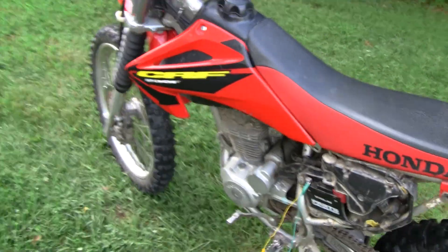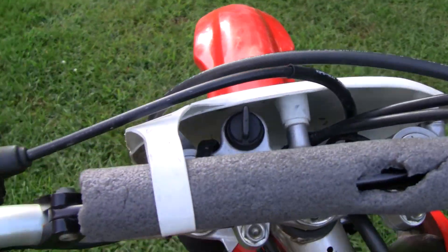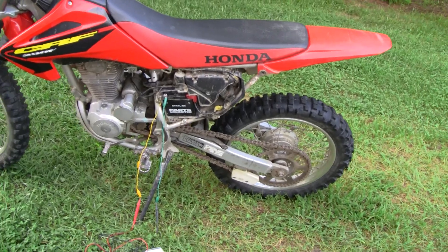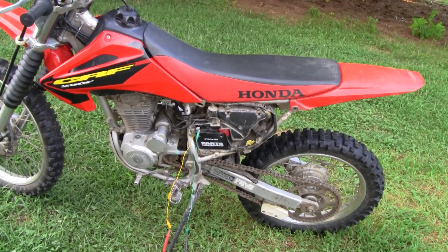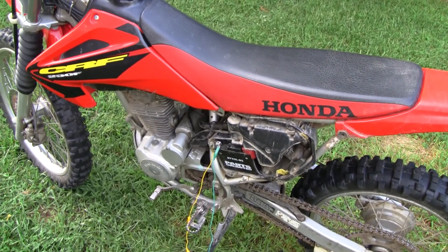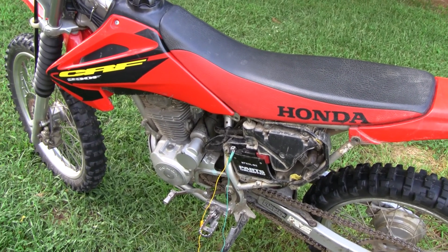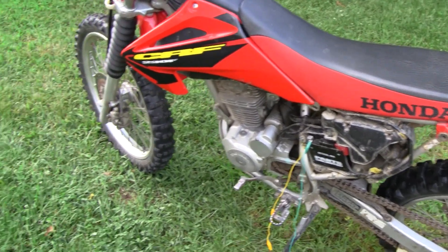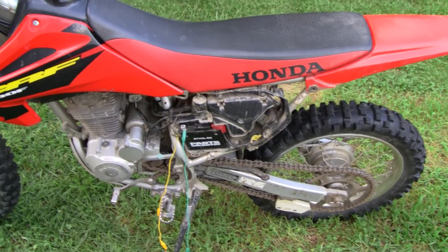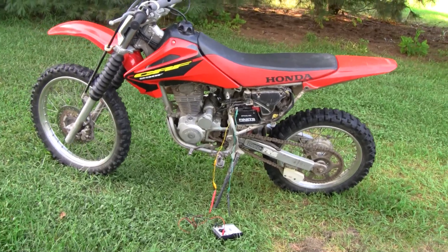So there's no current draw on the battery when you leave your key on. I'd feel safe saying that anyway, because I once left the key on for about a week while I was at camp and came back and it fired right up. Now we've confirmed it with the meter — nothing whatsoever. Keep in mind though: if you're into trail riding and you add lights, a speedometer, or a trail computer and wire that in with your key, that's obviously going to draw power and that will be a different story. Thanks for watching — follow me on Twitter at dirtbike5100.